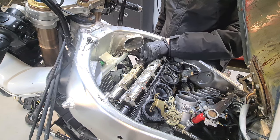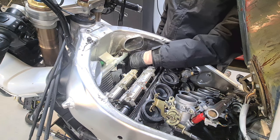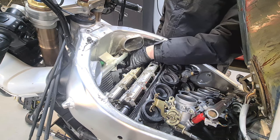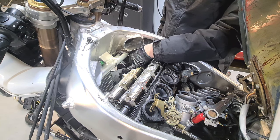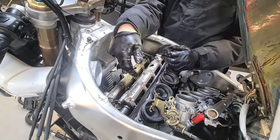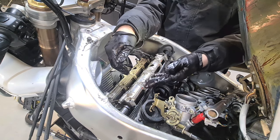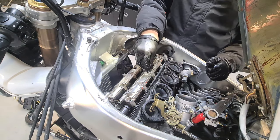Usually, what I do is I bolt the cams down before I fit the chain. And I test my valve clearances, but without being cocky, I'm that confident I've got this nailed. So it should be all right. Yeah, usually I do that. I check that the valve clearances are all in spec before I go ahead and fit the chain and everything like that.